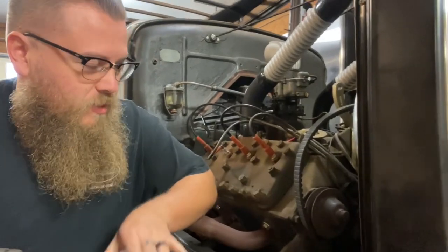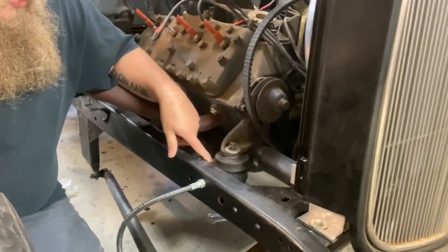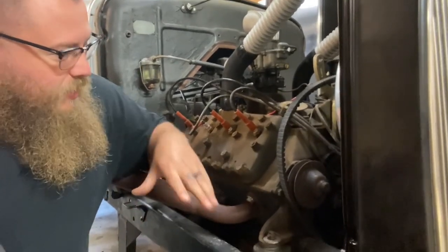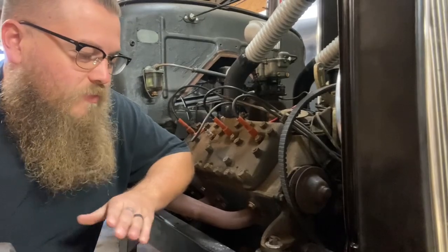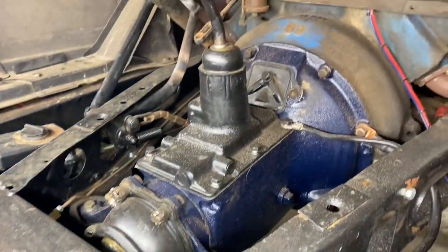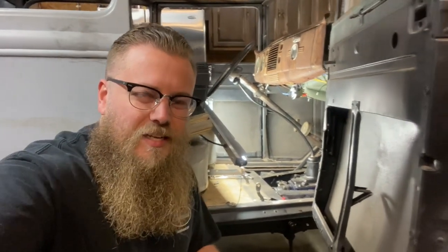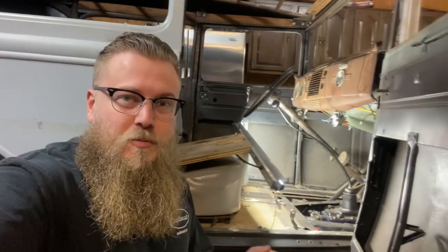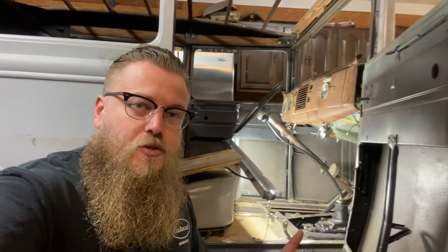At this point, I like to think the car builds itself. You know where the engine has to be level. I like to put my motor mounts flush or just below flush with the top of the frame. Flush looks really nice and brings the motor higher up into the cab. Once you figure out how you like yours, that determines where the transmission has to be, because the transmission just bolts right up to that. One thing you can look up and buy instead of digging through graveyards is Millworks Hot Rod — they sell really great engine swap kits that give you motor mounts, transmission mounts, and a crossmember that will allow you to run the original wishbones on the rear axle even if you're running a driveshaft.